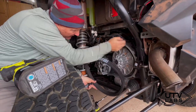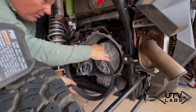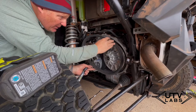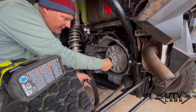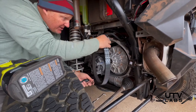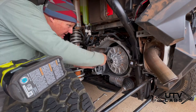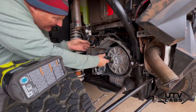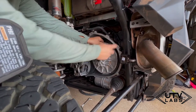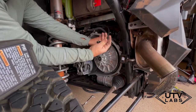What I found is inside the clutch, they said to put it up here, but you won't be able to because there's a kind of spline or support in there. So I figured the best way to do it is you're going to have to take the clutch apart and pull your secondary off, which is no big deal. I've removed the housing and the belt. The next big step is to figure out exactly where you want to drill the hole so the sensor can point down inside and get an accurate reading.